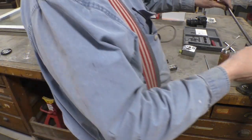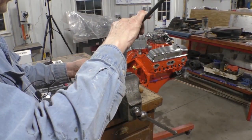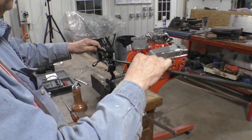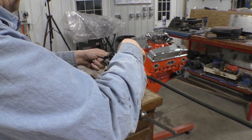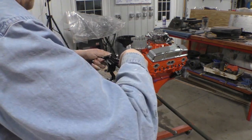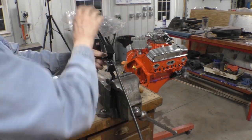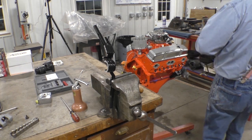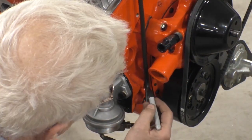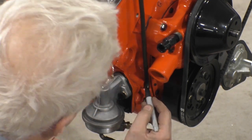So then we put it in the bender with the start of the bend at the beginning. And we hope that we've done everything right and we'll work our way around. I'm not gonna go that far and then I'm gonna check it. This is the bend we just made with the beginning of the bend right there and this being the inside.